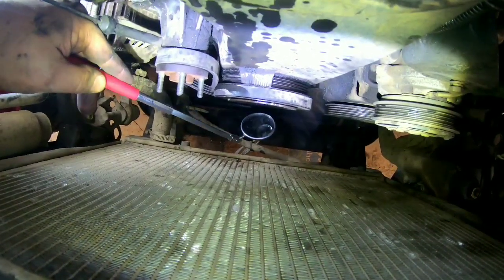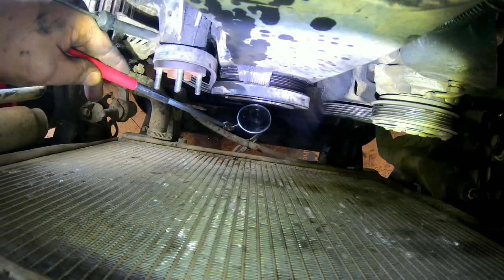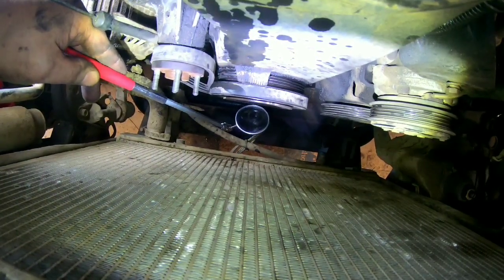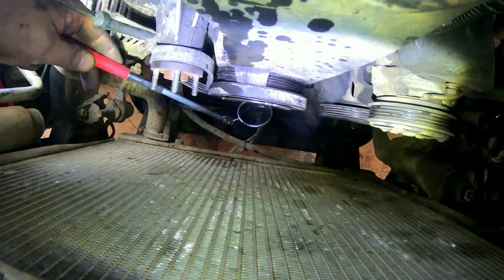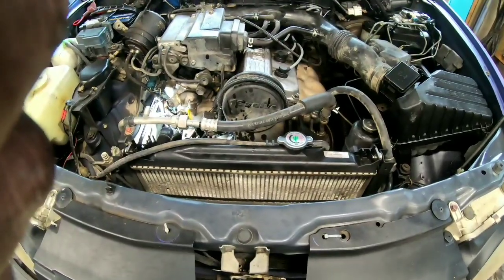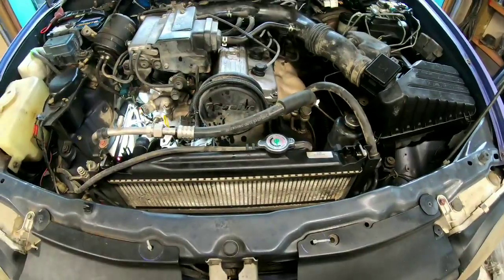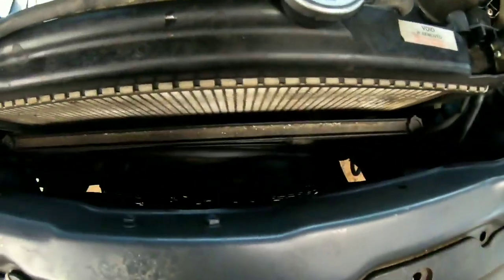I think I don't need to pull the big center bolt. I think I just need to pull those, what is that? 1, 2, 3, 4, 5 bolts there. But unfortunately, they're Allen heads. I'm trying to avoid having to pull this radiator, because it's an automatic transmission, which means I have to unhook and lose all the transmission fluid, and then I got air conditioning lines going across it, so there's a radiator there for the air conditioner.